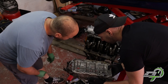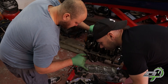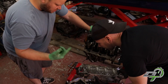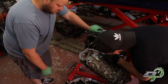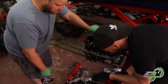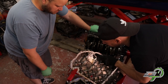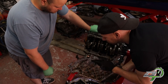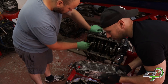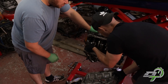There's the bearing material. That little oil gallery there looks like it's something to do with the pressure release. That's why it has a secondary pressure - that's something new. So that will have just been blocked and it's not getting its high oil pressure, it's staying on low oil pressure, possibly. So quite possibly a problem with that being blocked, something to do with the pressure release and subsequent oil pressure.